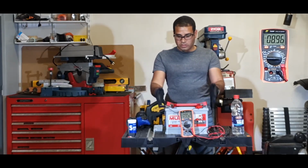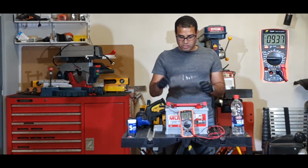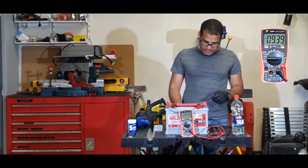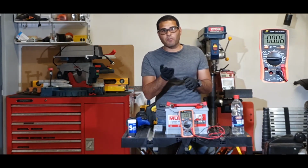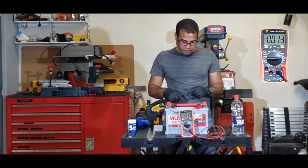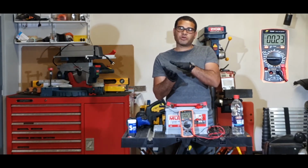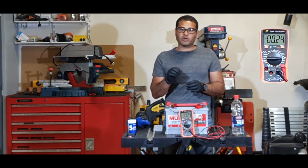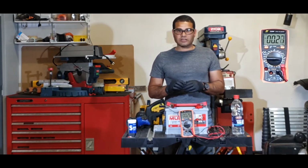All right, so the battery right now is empty. We'll start putting the acid inside. I'm just going to use an improvised funnel. There's a level for the battery, and any battery will have a marking on it. On this battery, there are two lines, I'll spin it just now after I fill it, and there's one line minimum and one line maximum. That's where your solution needs to sit. So I'm going to carefully and slowly fill the battery, and we'll speak after that.